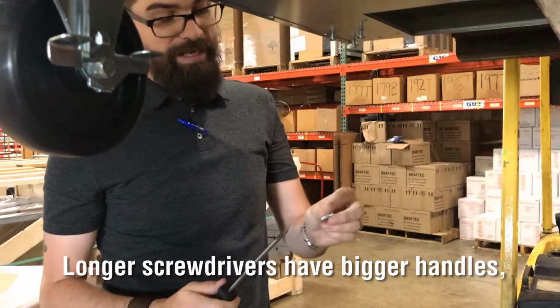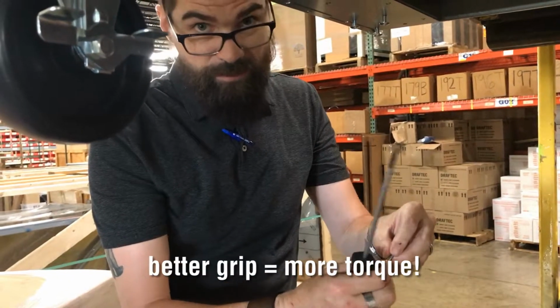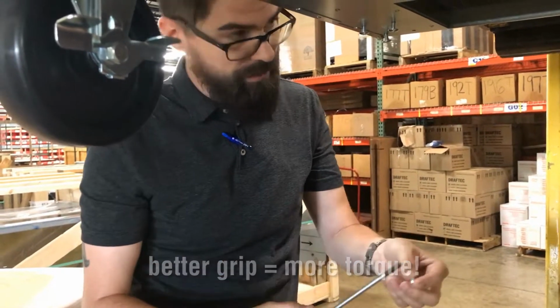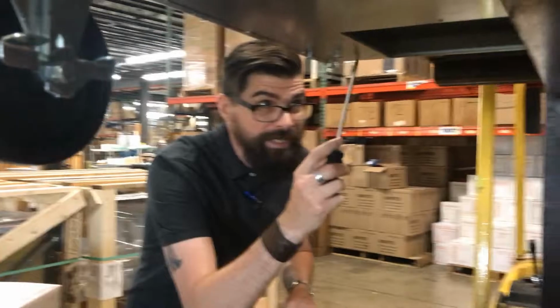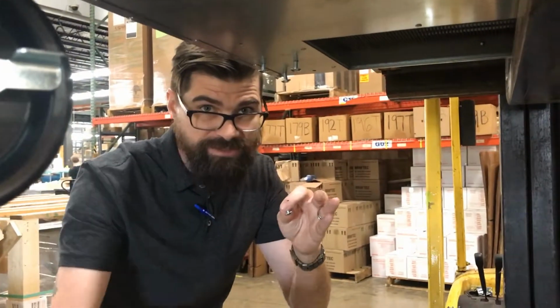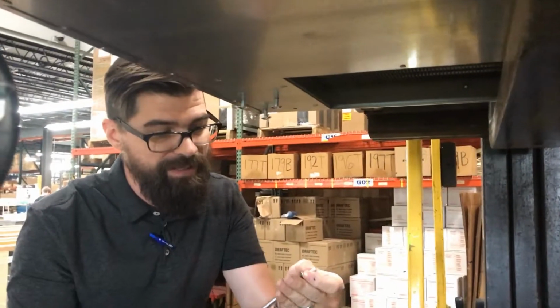The reason we want to do that is these screws, they are tapered, but they do need to cut into the metal as you secure this thing. It isn't tapped on the inside of the hole. So what you're going to want to do is locate your hole, and probably even before you start to stick the casters in, go ahead and screw these up a little bit so they can bite in. It'll make it easier for you.